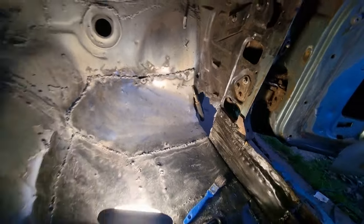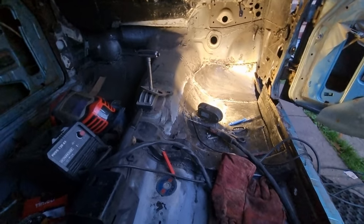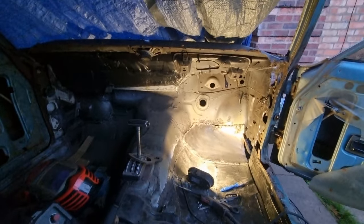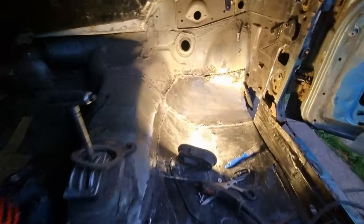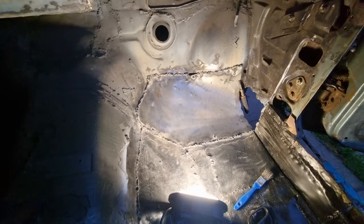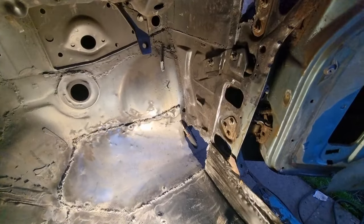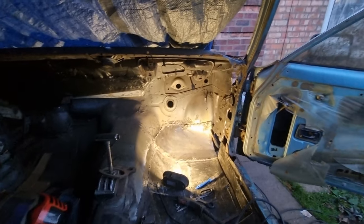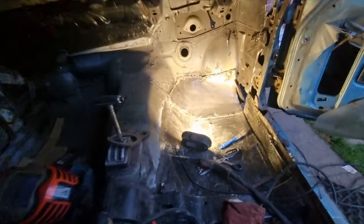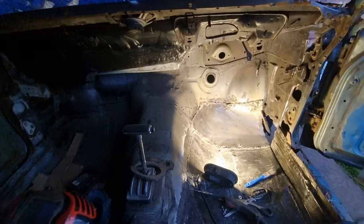It's obviously a two-day job. I'll do the inner bit there, and when that's in I'm going to grind it all, primer it, and then I won't be showing you any more of the floor until I actually start getting ready to paint it. Looking really good — I can't wait to grind it flat and primer it. Then I'm going to start working on the A-posts. That's why I've held off on doing the scuttle, because I need to do those A-posts up there first. I can't wait to get the dashboard and everything back in — it's going to start slowly coming back together.